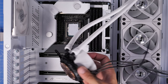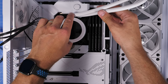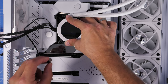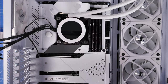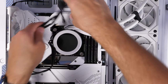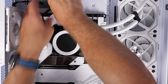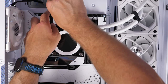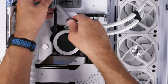One thing I wanted to show here was the issues with the Kraken Z73 — the tubes on the right hand side is generally how I'd mount it, but that pushes up against the RAM. So I thought I'd mount it with tubes up, which you can see is quite close to the VRM at the top, which is a little bit problematic. The other issue is then the main cables are on the left hand side, and trying to make them look neat is pretty difficult. You can change the display in the software, but when you run those cables to the back they sit over the top of the motherboard and it doesn't look very good. It's either that or have the tubes pressing up against the RAM.